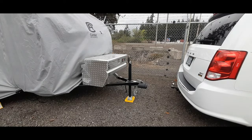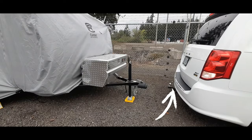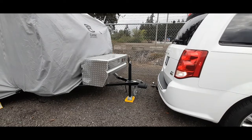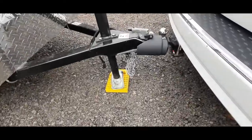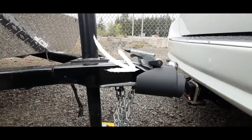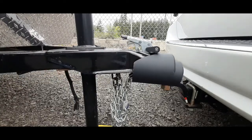As you can see, as I'm backing up slowly, I have not raised the trailer above the height of the hitch. This is also an example of why you don't want somebody standing behind your tow vehicle and the trailer. Make sure your trailer hitch is higher than the ball so that when you back up you have plenty of room and you're not hitting the trailer against the ball hitch. If you're not directly lined up, you can pull forward, turn your wheels, and make a better approach.